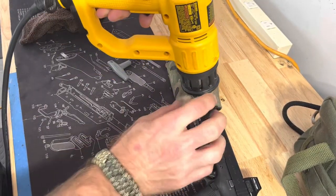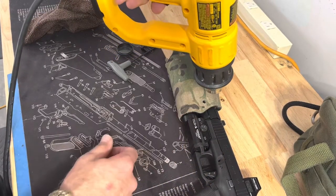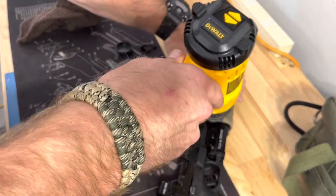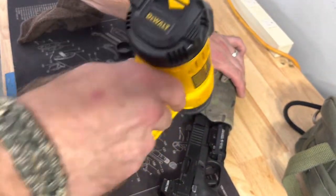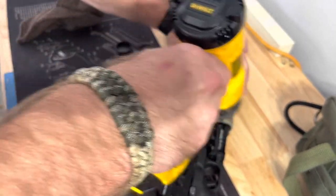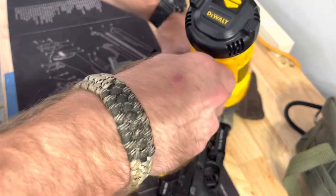You can try it, or I have made like a block or something that goes in there to try to open it up. The thing is, you don't want to get this too far off because then it's hard to get the screw back together. I'm going to heat this up just a little bit more and keep molding. If you want to know what my heat gun's on, it's set on 600, but I keep it back a little bit. You don't want this thing to get too hot — it'll start deforming the rest of the holster.